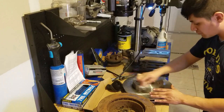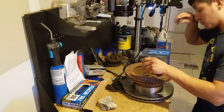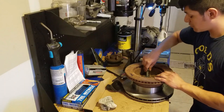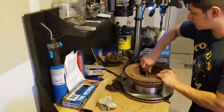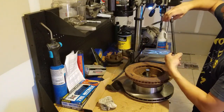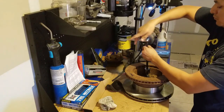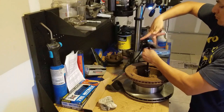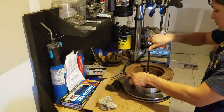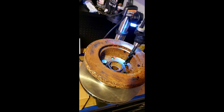We're going to clean our mating surface and place the Cherokee rotor directly over it. Here I'm using a 5/8 bolt — I've got a 2-inch bolt, but something like a 1-inch or inch-and-a-half bolt should be fine enough to put a nut on the other side. It's not necessary though, as this 5/8 bolt kind of grasps onto the edge of that hub assembly and gets stuck on there, which is enough to keep the rotors from turning on each other.